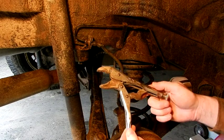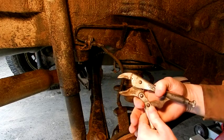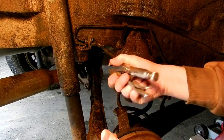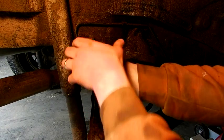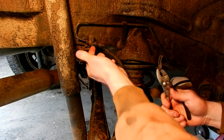I like using vice grips to try and get these loose. Line wrenches just seem to round off the corners and they never work right. But these will grab right on, and then you can work it and work it and work it. Okay, we're going to pull this thing out. Now it's working — there we go. And now this should be able to come out.